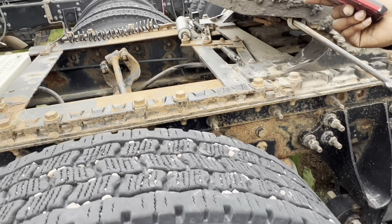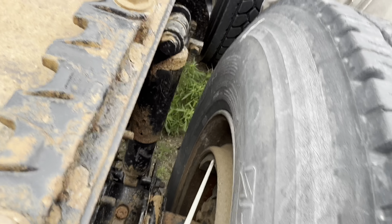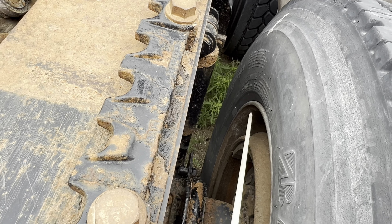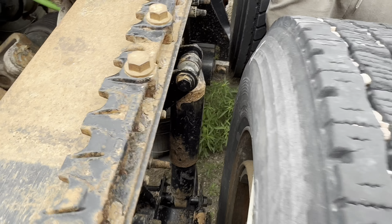Then I got my brake lining — not cracked, not dangerously thin, not broke. My drum is not cracked, damaged, or broke. No illegal welds. No oil or debris in between the two.